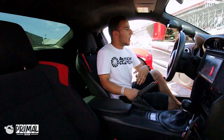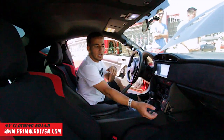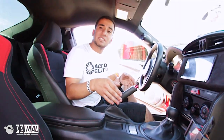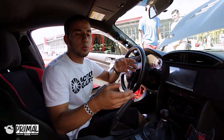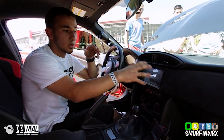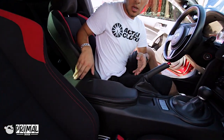You can see here we've retained a lot of the factory interior. The car really is a street car, and with that you need amenities like air conditioning and power steering. We do have the AEM gauges here on this pillar — boost, oil pressure, and AFR. We actually were able to keep the stock shifter location with a T56 transmission out of an 06 GTO — a T56 six-speed transmission. It really handles the power a lot better than the factory transmission. We molded together the two dash pieces and added filler pieces to run an aftermarket radio — a standard double-din Pioneer radio.